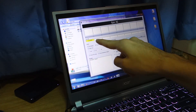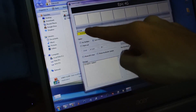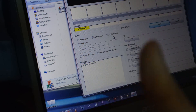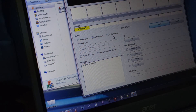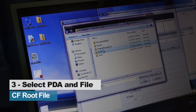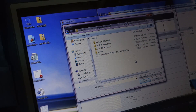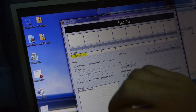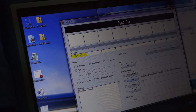As you can see, there's a yellow dialog here, meaning that it's connected properly to the computer. Make sure you've also got Samsung Kies installed — those are just for drivers so that your Samsung Galaxy S2 and your computer can communicate with each other. What you have to do is find the file. The file name is something like cfroot_sgs2, and the last characters are cwm5.tar. Find that file, click open, make sure it's under PDA, leave the rest of the settings, and click Start.